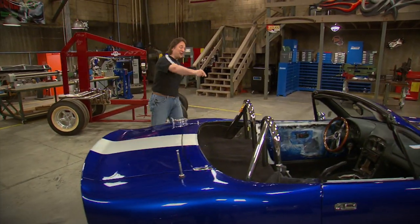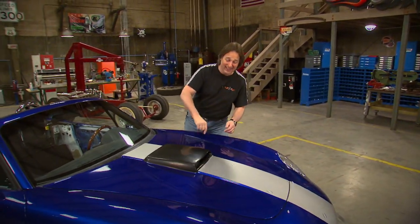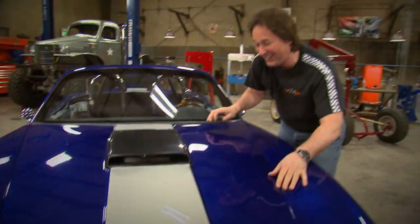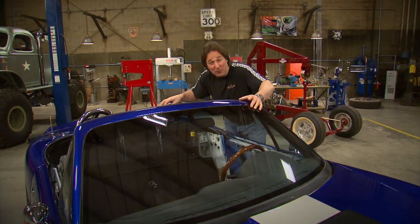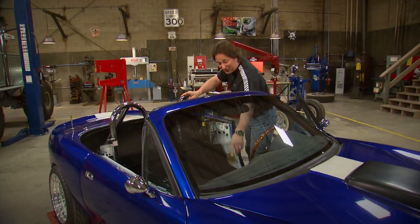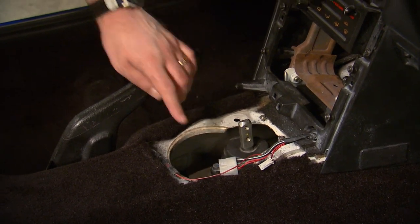We're back and working on the Banshee, and it's getting closer and closer to being done every day. I've got the engine back in, which gives you a good chance to see how well that engine fits and how that air cleaner is going to fit around that hood scoop. The reason the drivetrain's back in is that we need it to help fit the next components, like the shifter. We've been getting a lot of questions about the shifter placement on this project. The new T5 shifter is coming up here, but the stock Miata shifter came up here — so if we're going to hide all that stuff with a stock console, we have to move the shifter back and to the right.